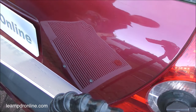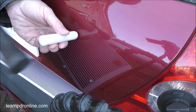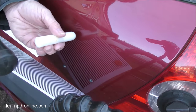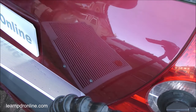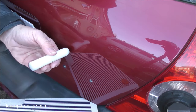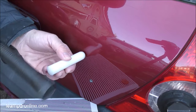It's so important to keep checking your work throughout the repair process, really keeping an eye on any kind of hidden damage. As you start to release tension from one section of the panel it's easy for that tension to move into another section, so it's always good to keep reassessing - keep moving your reading device whether that's a line board, fog, or lights - and really make sure that you as the technician can see exactly what you're working on at any particular time.